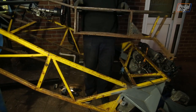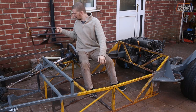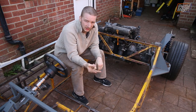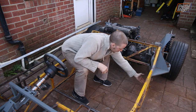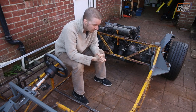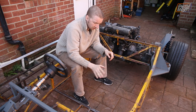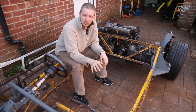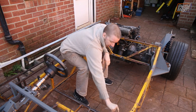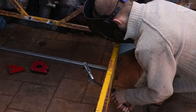This is our new removable center section. Pretty much as expected, when we cut it all apart tons of rust fell out. With it out of the way we've got room to put in all the new supports we need to hold our seats up. The rear cross member is nice and simple — a big cross member across the entire rear end with no gap in the middle where a differential would normally go, so it'll be stronger than the original. The other cross member will support our seats and run roughly from here to here. The idea eventually is a single-piece removable flat-bottom floor, which means the seats can't bolt directly to the floor — they need their own structure: longitudinal supports that the seats bolt down onto, supported by the cross members we're putting in.